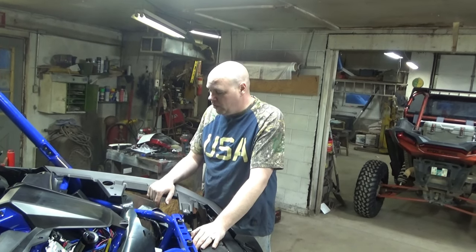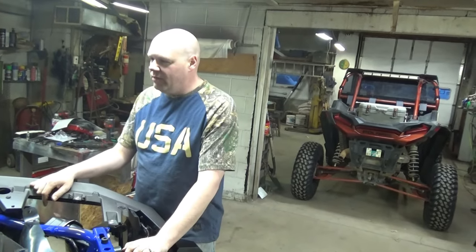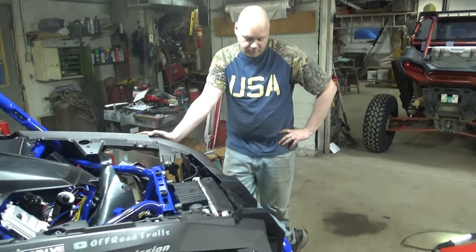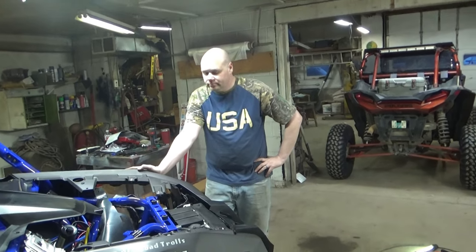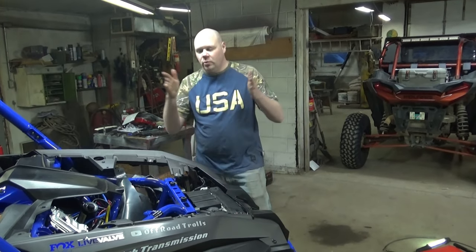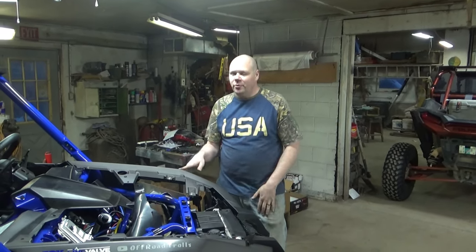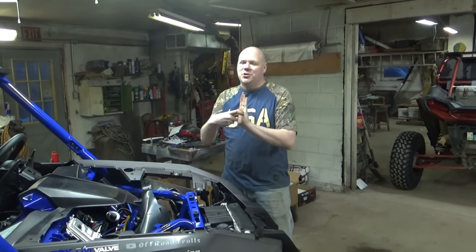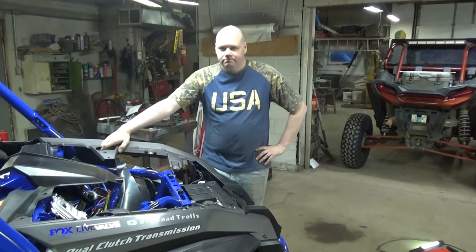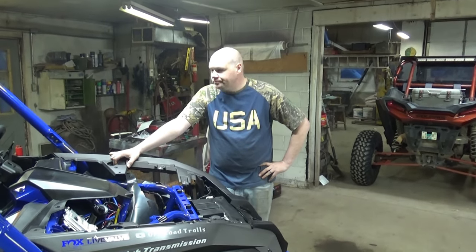So that was quite the project. But everything's tested, everything's working, everything seems to be extremely high quality — we're very happy with that. We struggled very hard with the four bolts to mount the winch to the winch plate. That is not necessarily Super ATV's fault — it's just a very tight, tight space. I got the 4500-pound winch, which has a wider base than the 3500, which is what most people actually run on these little things. The 3500 would have screwed right in no problem. The 4500 goes right up against the clamps that go around the tube frame, up against that mounting point. Could different engineering fix those problems? Yeah, but it works, it's in, it'll be there until it doesn't work anymore.